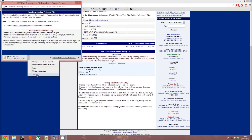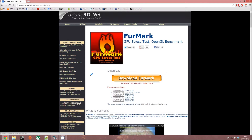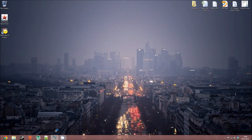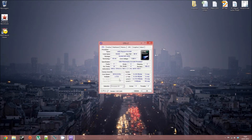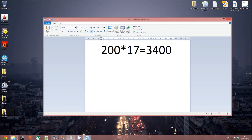And you need to grab FurMark, which is a GPU stress test. Now, this is CPU-Z. As you can see, the frontside bus is not showing and the frequency is kind of strange. But the frontside bus is 200 in all Phenom 2 CPUs. So if it's 200, and if you have a CPU with an unlocked multiplier, you can just raise your multiplier — which in the 945 is 15.